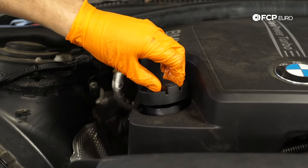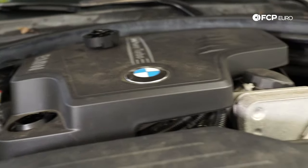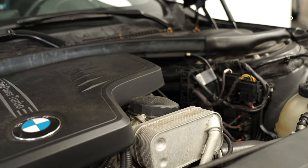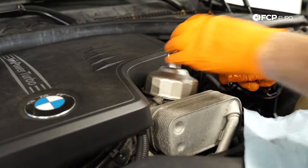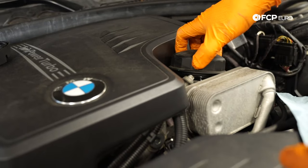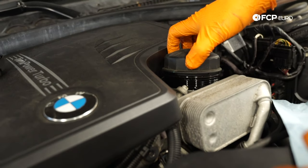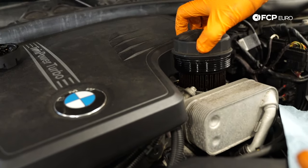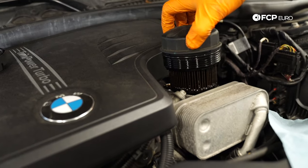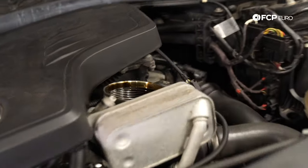Now that the oil is draining, we're going to remove the oil cap right there to make sure there's no vacuum in the engine and that everything can drain out. Now we're going to loosen up the oil filter housing. Grabbing a clean rag and the CTA oil filter wrench, I'm just going to loosen this up. Go slow with this because if you pull it out too quickly all the oil just drips around the edges — let it really drain down. I can grab this with a rag and get it away from the engine. You can see the oil draining out as we go.